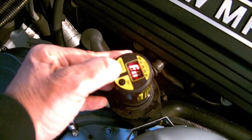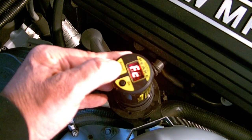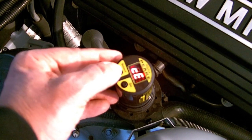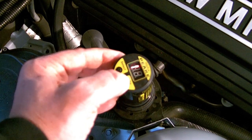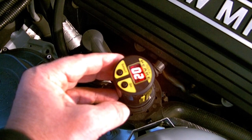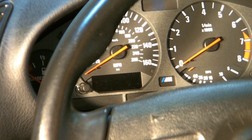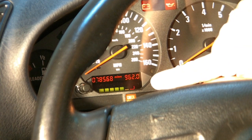Then there are some other sections of the menu that aren't relevant unless you have a V12 in your BMW. To reset the oil light, simply use the select button to scroll to that part of the menu — that's the OL — and then hit the go button to execute. After that's executed, you'll notice that your dash lights will have changed the next time you start your car. The same holds true for inspection one and two. The next time you turn on the ignition, all the oil indicator lights will light up on your dash.